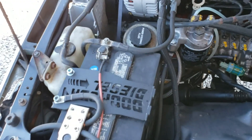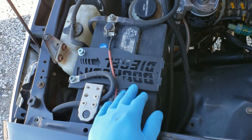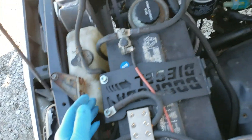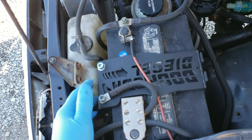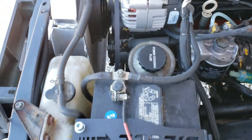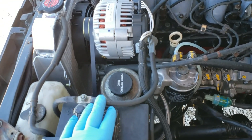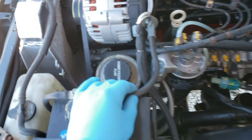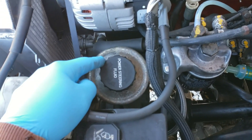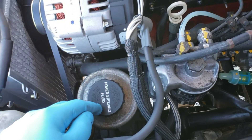I have a newer version of the Doomsday battery tray which allows fitment nice and tight up against the overflow tank. It's a short run from the alternator to the battery, which is really nice. We have our power steering pump down in here — we are not using a fluid cooler, but if one ever needs to be utilized we can actually go down to the radiator and use the transmission cooler to cool the power steering fluid.